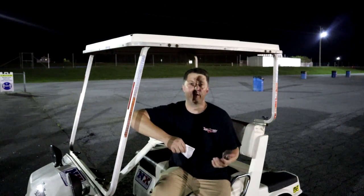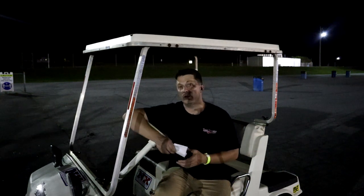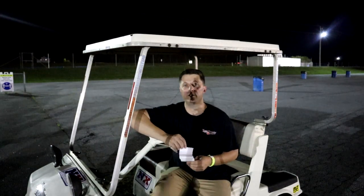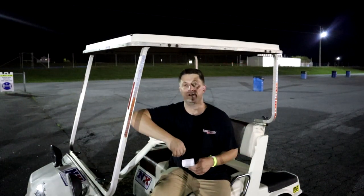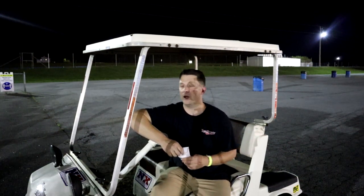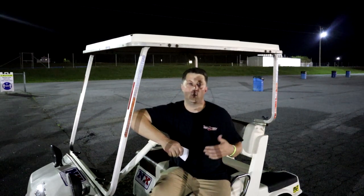And, you know, the 1.5 60 foot took a 100 shot roughly out of the hole. So far, we're down to 1.7s, but we're still two tenths away. So we'll just have to see what we can do. Hopefully, colder weather will get us down there. Maybe some better tires. We might have to go to a full slick. We're running drag radials right now, so maybe going to a full slick will help it out.